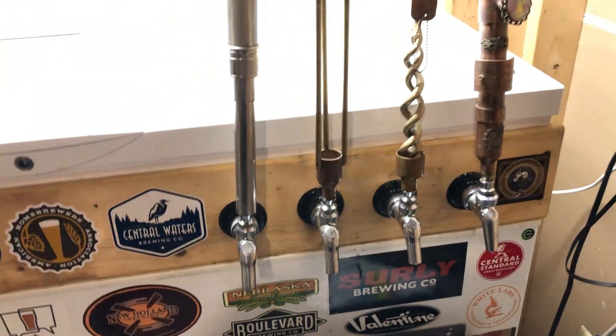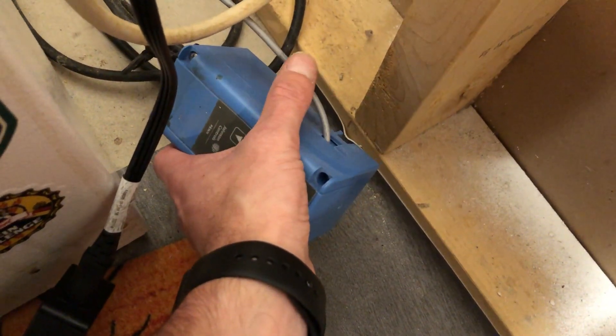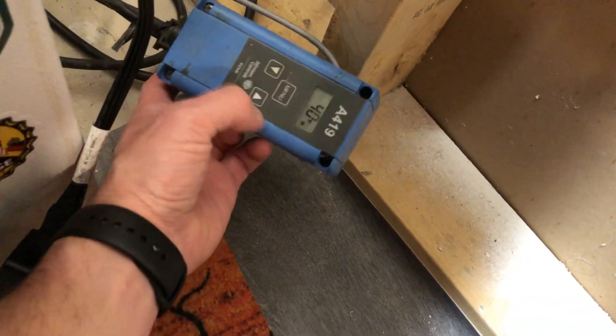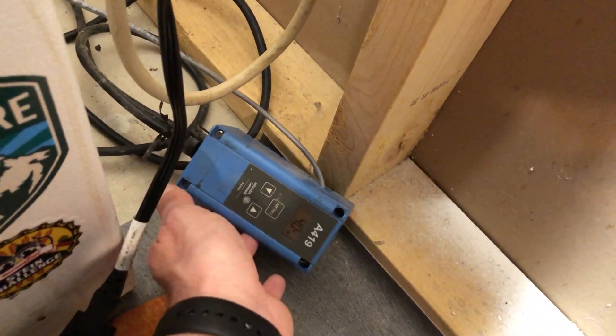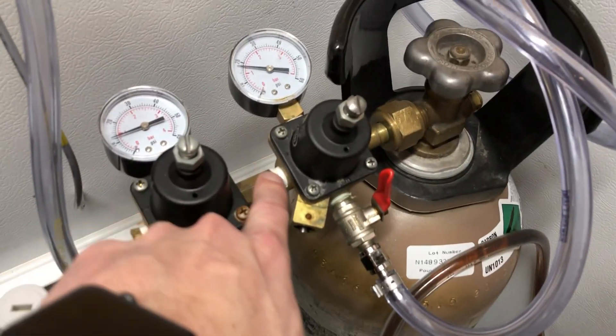One thing you're gonna want to do with this freezer is that it's made to freeze. I have one of these temperature regulators made by Johnson Controls. There is a thermocouple that comes out, you plug in this unit, and there's a plug in the back that you plug your freezer into. What it does is interrupt the temperature at 38 to 40 degrees — I just have it set there. There's another one made by Inkbird that I have on my fermentation chamber; it's cheaper than the Johnson Controls one, but I bought that one first.